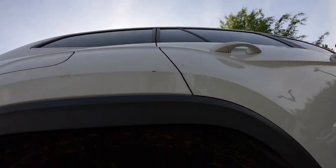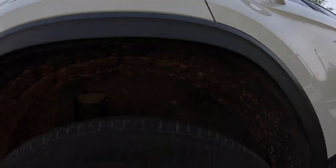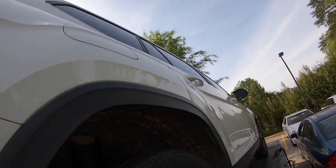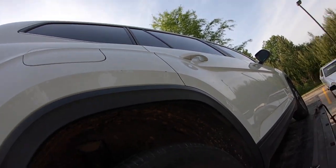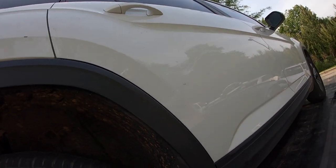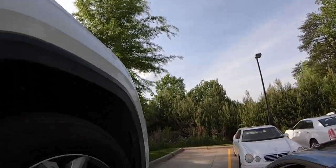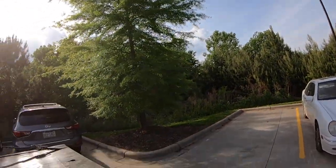So, it's always good to have at least four skates, because let's say all four wheels are locked up, you could use all four skates. In this case, the rear wheels are locked up and I was able to get the front in neutral. So because I was able to put the transmission in neutral, I have at least one set of wheels that roll versus four wheels that don't roll. So let's say it was stuck, like a Mercedes-Benz, all four stuck, then I could use four skates.